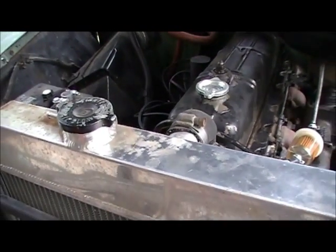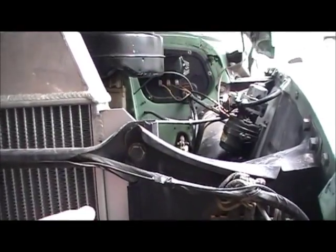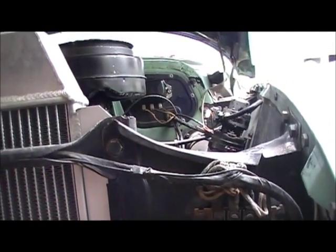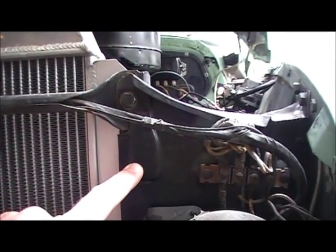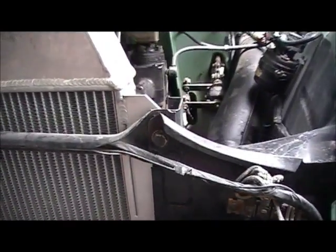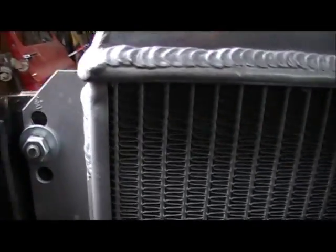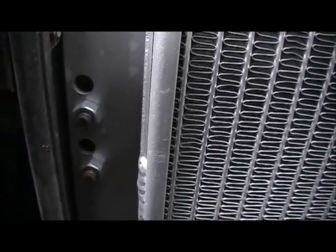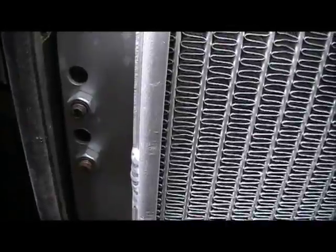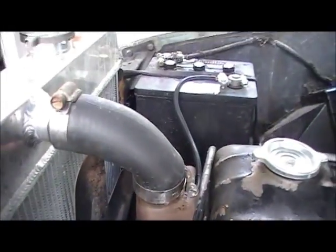Here's one of the things I had to do when I put this in: all four bolt holes on both sides — the holes in the radiator bracket were not correct to line up with the radiator support in the car. You can see it came with a couple of different holes, but none of them line up. All the holes are about three-quarter inches high, so I had to redrill four holes on each side — no big deal, easy to do.